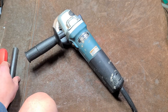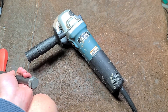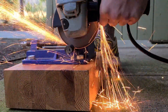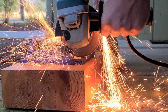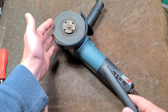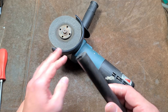I did a cut-off on a pretty thick grade 8 bolt — the head is a one and a sixteenth inch, I think it's a three-quarter inch shank. I had it turned up to about level three or maybe four, and the four and a half inch wheel was only running at maybe 7,000 RPM or so, and it actually worked pretty well.